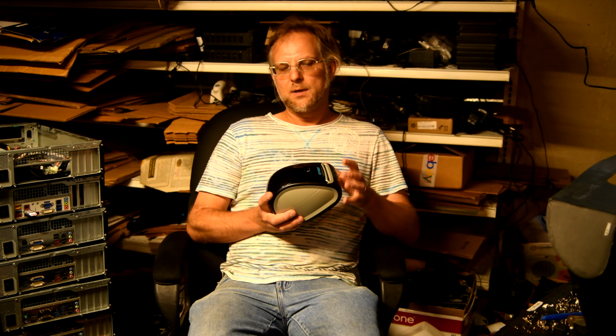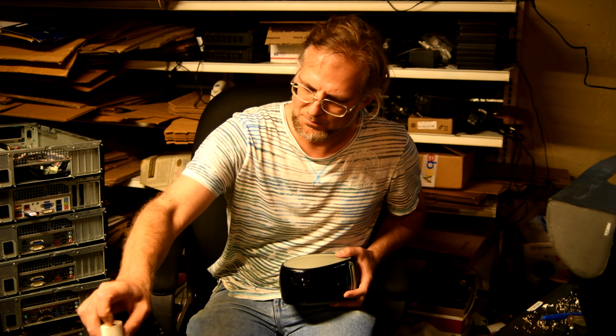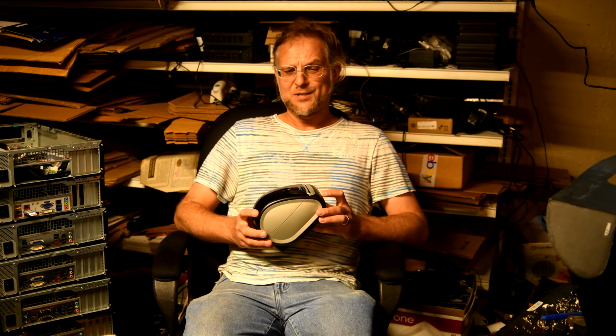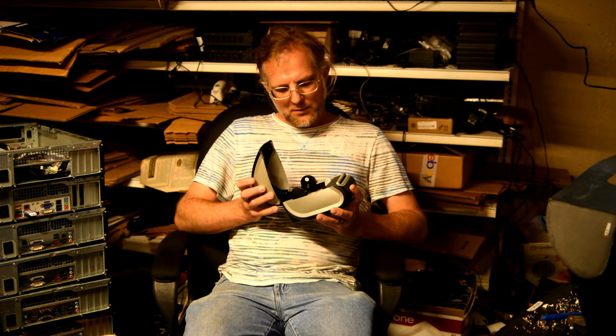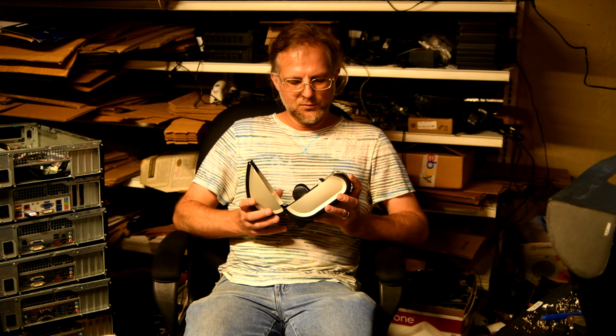After going onto the internet and downloading a driver for it and trying to print with it, it told me that there was the wrong size label inside of it. Well, I'm just using some credit card terminal roll because I don't want to put expensive labels through it just to test it. But then I found out that it requires expensive labels. So it's got some sort of DRM in here that prevents it from just printing to whatever label you want to put in it.